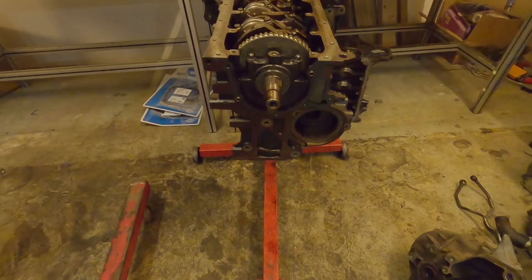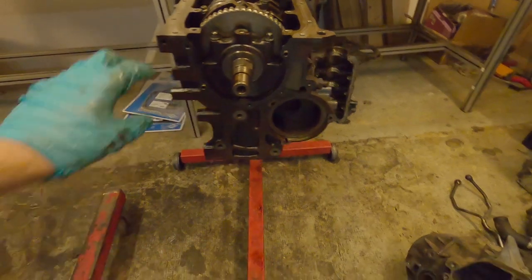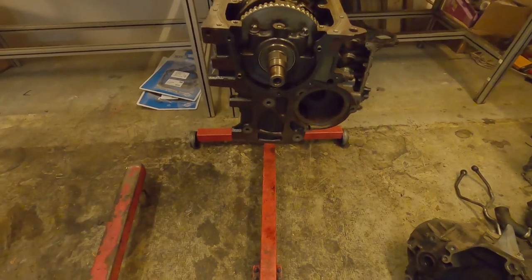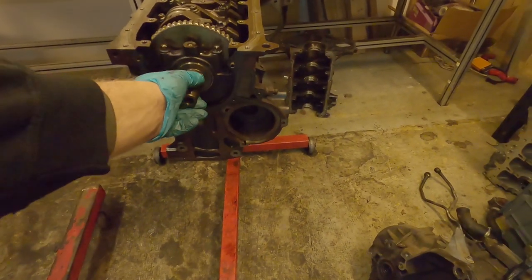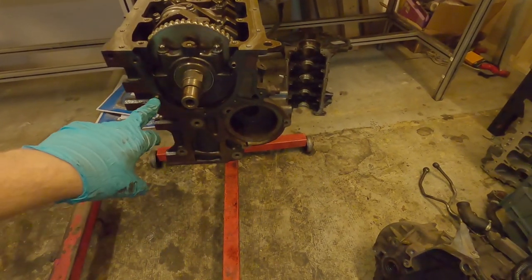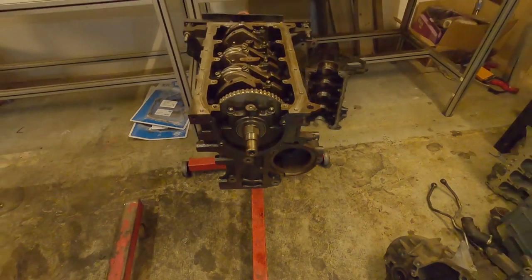First of all, we need to install our oil pump, because before we install our girdle and all our oil pickup, the oil pickup goes to the oil pump. The oil pump sits on the end of the engine here on the end of the crank. We have a gasket to install, so you need to clean your surface, clean off your oil pump or get a new one — it's highly recommended while you're here to put a new oil pump on. Ensure you can work out what angle your crank's at, because the oil pump has to go onto this notch on the crank. Rotate your oil pump so it's roughly the right place, slide it onto the crank, and you'll see there's alignment dowels to help you position it. Once that's on, put your bolts in to hold the oil pump.